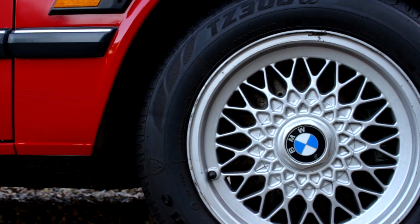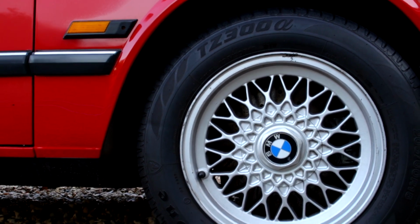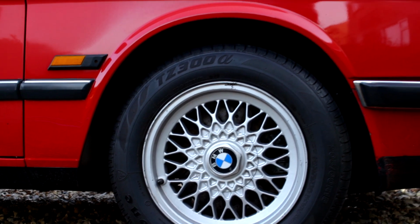Very much the same as this stuff, 3CS from Garage Therapy. They are very, very similar in the application method. I don't know what's in this or that, but I do know the application is pretty much identical. As you can see, the car is not exactly dirty, so we are going to have to go through the necessary steps and get rid of whatever was on the car before, i.e. strip off the last stage protection using some Garage Therapy decon shampoo, and we are going to be using an IPA, because that's really important when we're doing machine polishing.